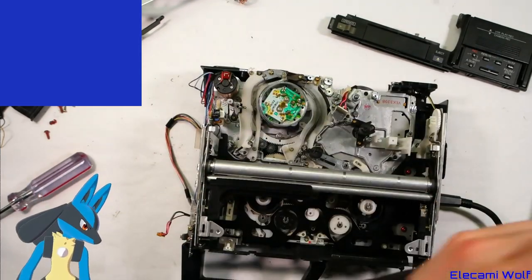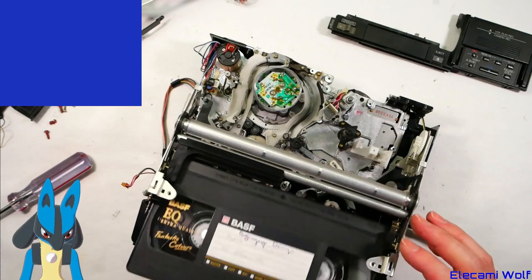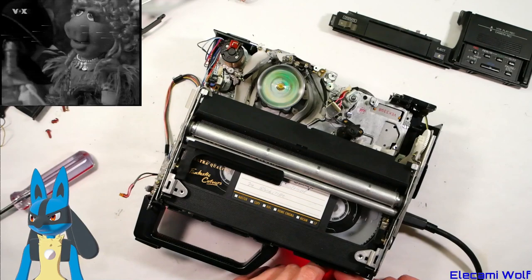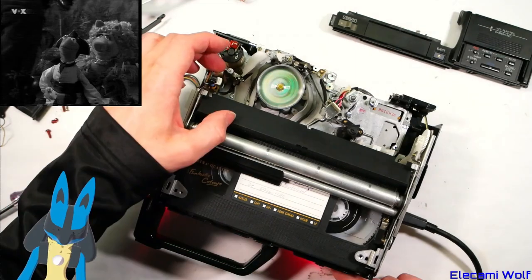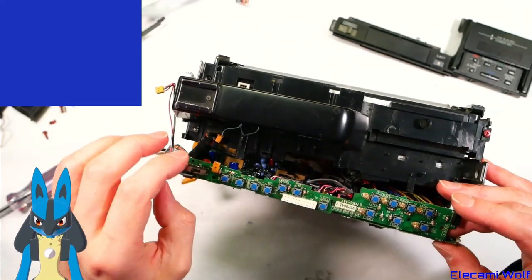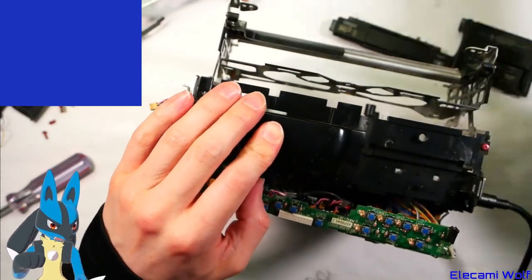The capstan is pretty gross and dirty as well. Back tension band, tape loading guides. The pinch roller is also a bit crusty. So this is a well-used machine. It's still black and white. Anyway, it's generally functioning — just the chroma is missing.